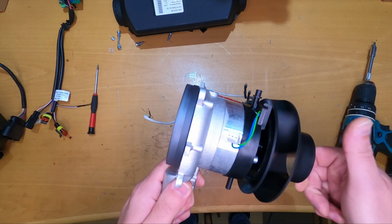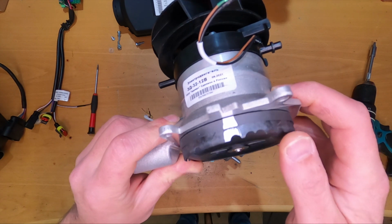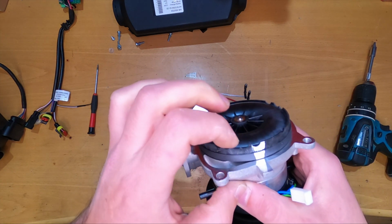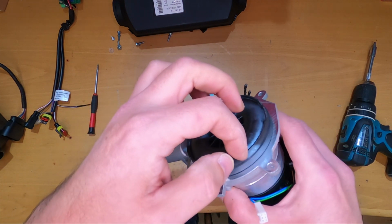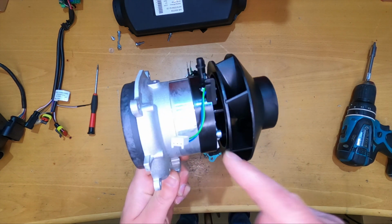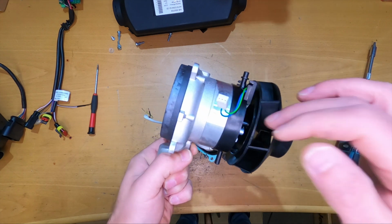And let's take a closer look at the blower. So we can see marks here, some tear downs from the plastic here. So this means that the blower is balanced. Yeah, and this is how everybody usually balances the blowers. Atmosphere also has these things when they break plastics from this side in order to keep the blower balanced. We cannot see what's in there anymore because I don't want to take this down. It's just not worth it to unbalance the blower just to see what's here.